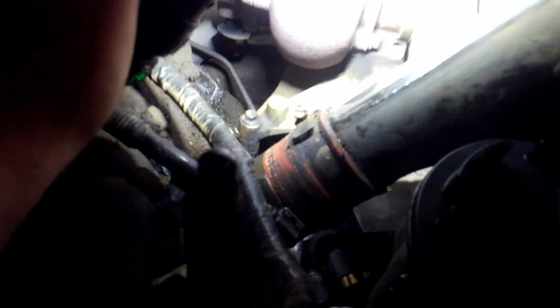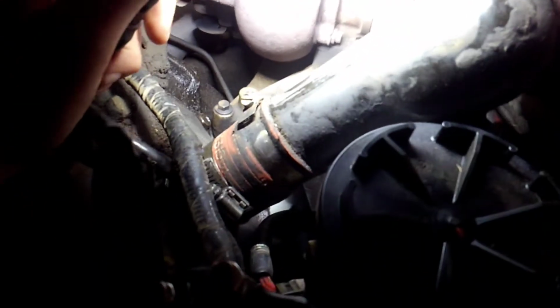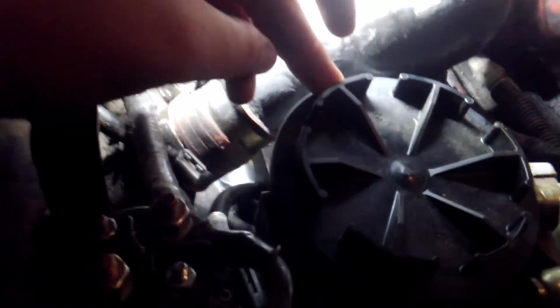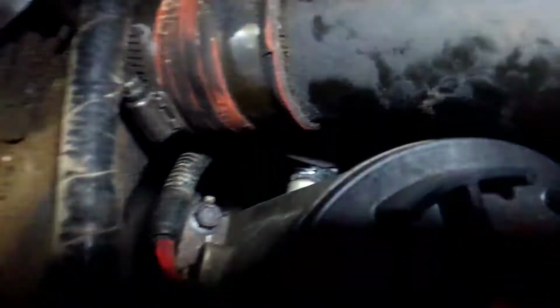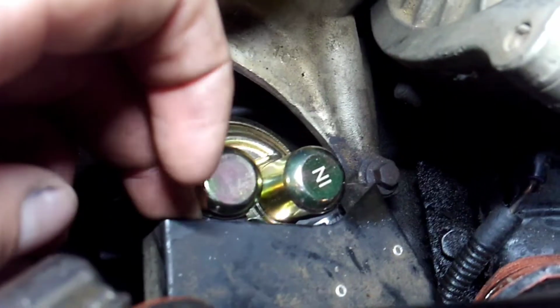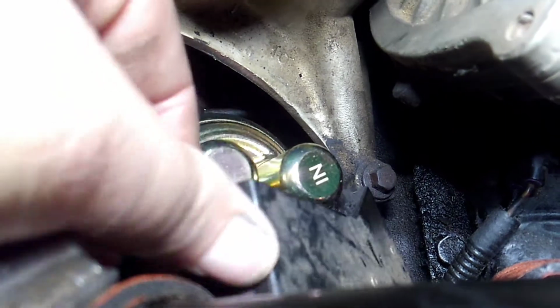That's just like a hydraulic fitting or anything you'd see. There's 2 10mm bolts that hold that thing in. Let me get down here. There's the 2 bolts that hold that in, 10mm. You pull that out, and the 2 bolts that holds this fuel bowl housing is 13mm. You pull them out, and then there's 2 lines under this. Okay, ain't gonna be able to see nothing in this video, but there's this cover right here. This just pops off like that.